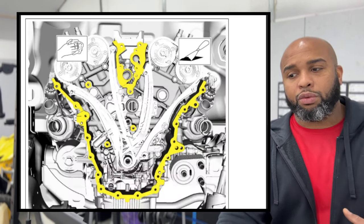We have our high pressure fuel pump sitting right here with our new bolts. Ford did recommend that we throw these on. I think these were the Torx 45 that we ended up using. So what we'll do is tighten everything down. So you install the mounting plate. Let's talk about how to install the mounting plate and how to torque it down. I did not have to reinstall the mounting plate.